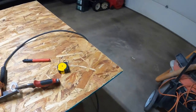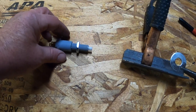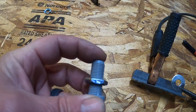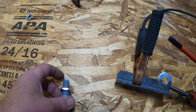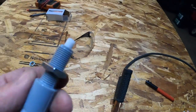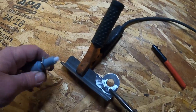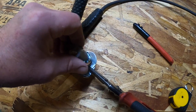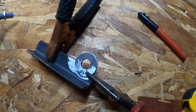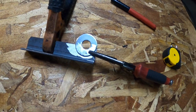Working on getting the brake light switch going. The one that was on the car is jammed up and not working, so I acquired a late-70s Ford Bronco brake light switch. When the plunger is in there's no continuity; when it releases it trips. The brake pedal arm rides against the plunger. These are easily accessible at O'Reilly's or NAPA for about six bucks. I need to weld a piece of angle iron with a round hole mount for the switch, with two nuts on either side to adjust the plunger depth.